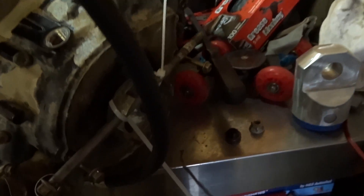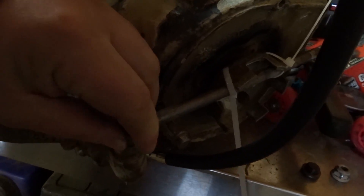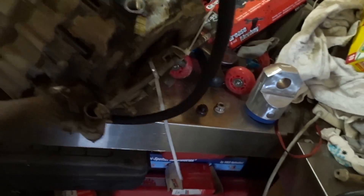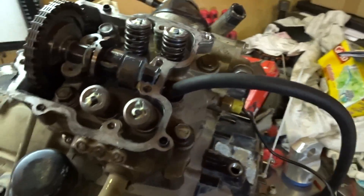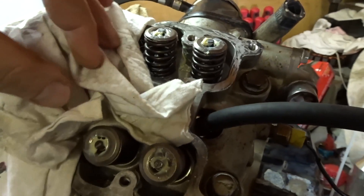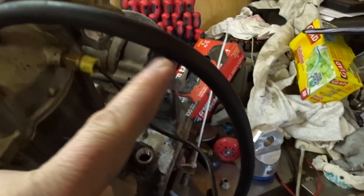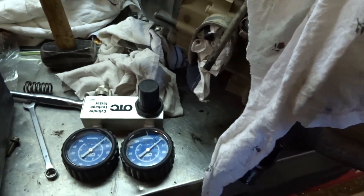What I did is on the side I put two bolts in and I zip tied a bolt to it so it will creep a little bit, but it'll still have air — we don't have to worry about the piston coming down and the valve dropping in, which would really suck. I put a rag in here to help protect the camshaft and also the chain, to stop a valve keeper from flying down in there, because they have been known to fly out.